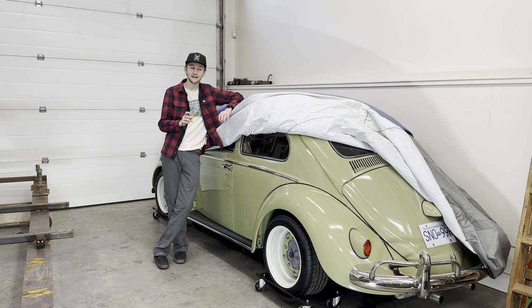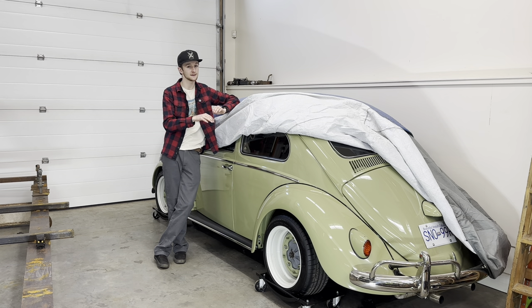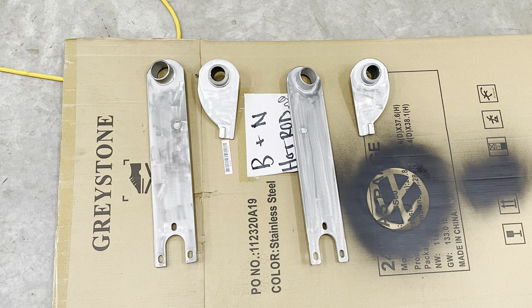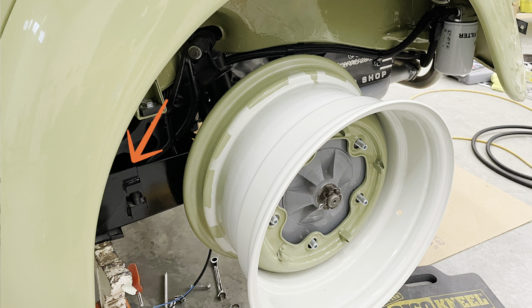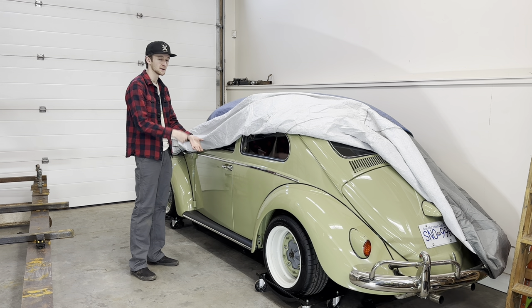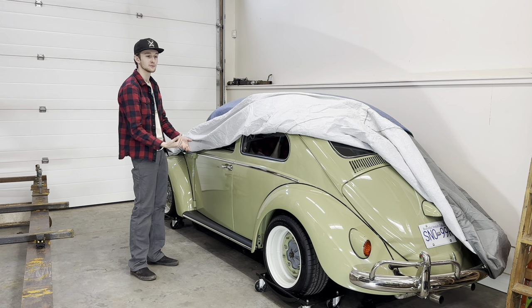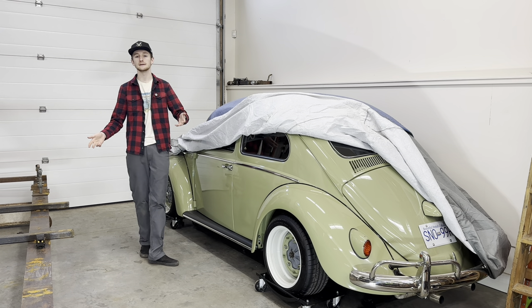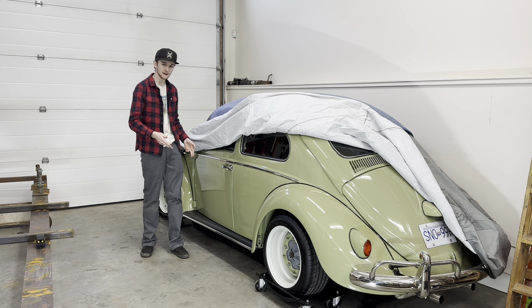In the back you can also buy an adjustable piece — not for the torsion bars themselves, but for that arm that goes from your torsion bars down to your wheel. It replaces that whole thing. One piece goes from the torsion bar halfway down the arm, and another goes all the way down. Between those two pieces there's a screw that sticks up and pushes against the panel on the torsion bar splines. Tighten it so the screw comes up and it raises your suspension; loosen it so it comes down and it lowers your suspension. That's the setup I have for adjustable suspension front and back.